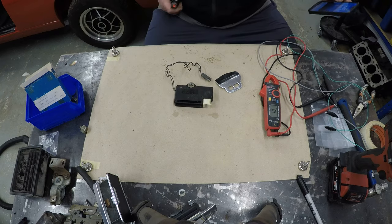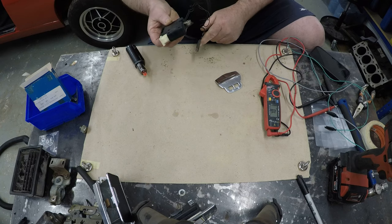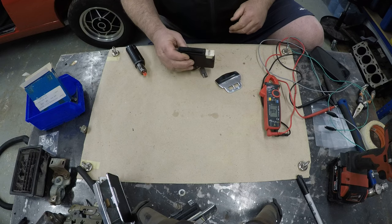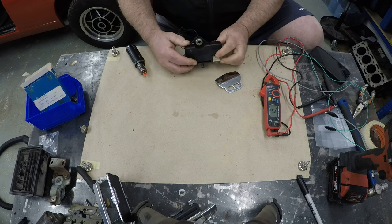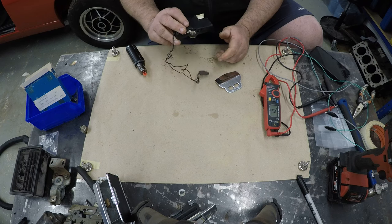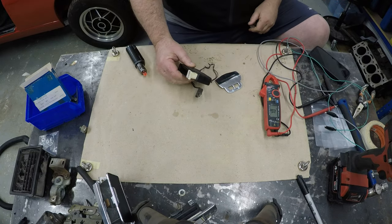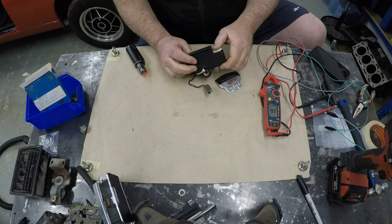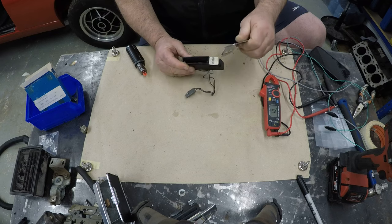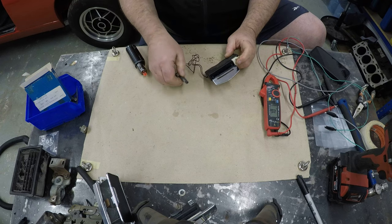Okay, so seatbelts. I've got a couple of these receivers - these are the original Triumph ones fitted to the Mark II Stags with a seatbelt warning feature, which is a micro switch inside. The problem with these is the seatbelt warning feature isn't working. These are riveted together. Most people wouldn't bother trying to repair them - they'd either replace them or put in more modern seatbelts, but I wanted to keep these because they fit really nicely in the car and into the original carpeted binnacle. So this is an old tongue, and as you can see it should disconnect the micro switch inside to switch off the seatbelt warning light on the dash.